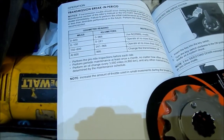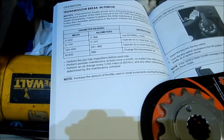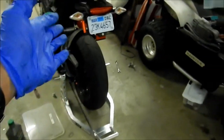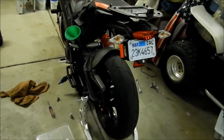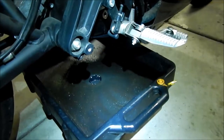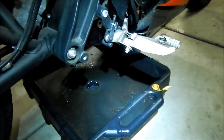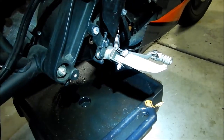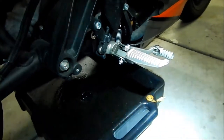So what I'm trying to do is get ready to go to the track — I want some fresh oil in the transmission before we hit the track. Right now would be a good time to change it. Plus, as you can see, it's still coming out pretty nasty with lots and lots of metal in the oil. Until that goes away I'm pretty sure the bike is still trying to break itself in — it's taking a while.